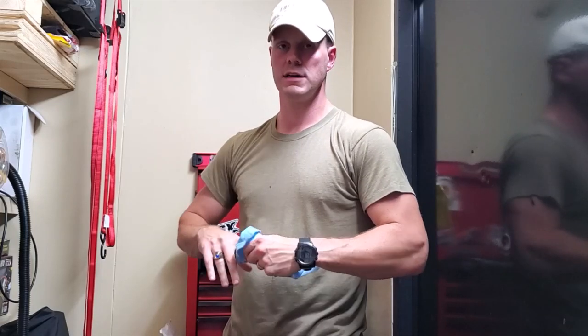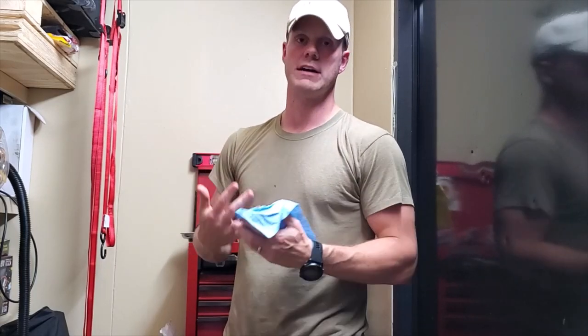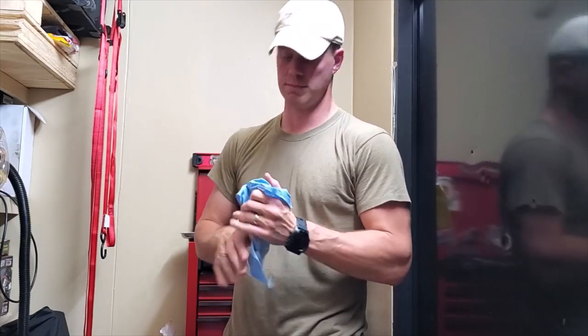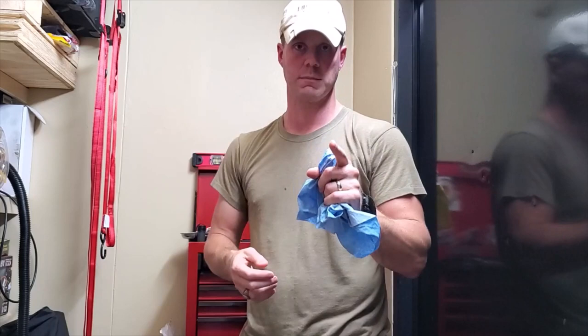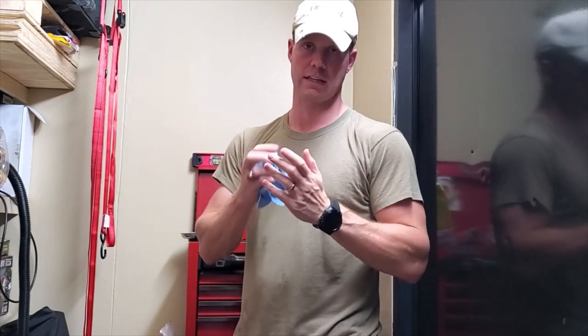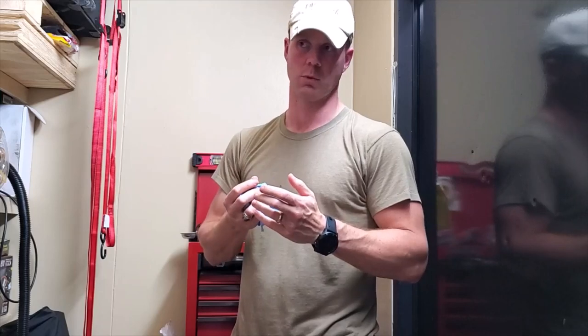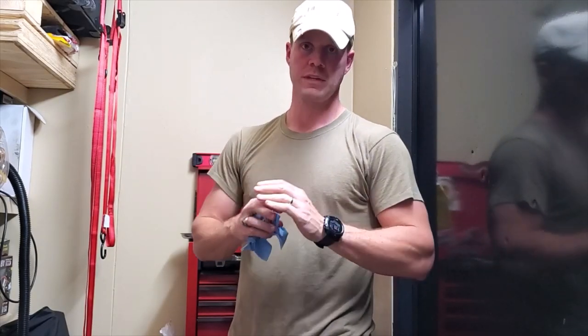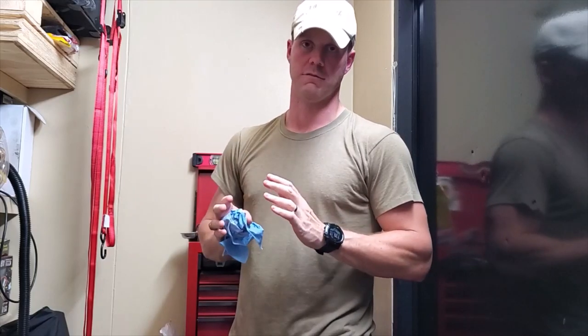It's not bad news, it's not anything to be afraid of. If you've never taken a filter apart before, then you would not know that that's just normal to have some metal in there. What I forgot to mention is that if you do see brass inside the filter media — and it's going to be a little more copper colored — if you do find brass in your filter, that is a telltale sign of bearing failure.